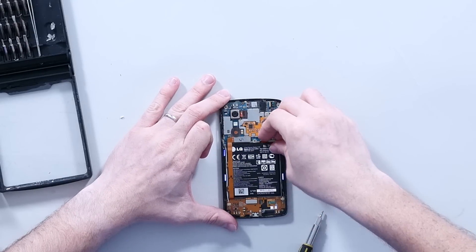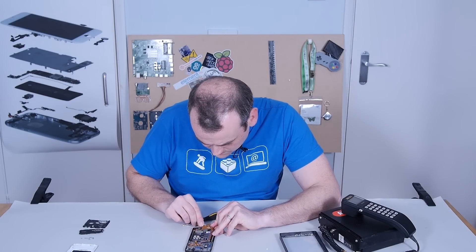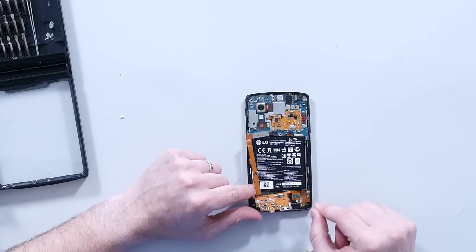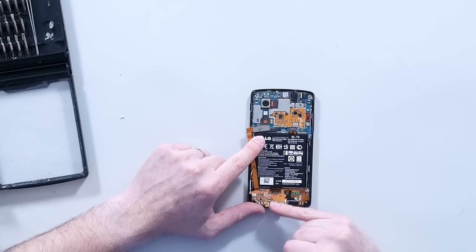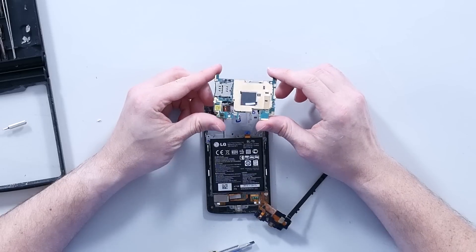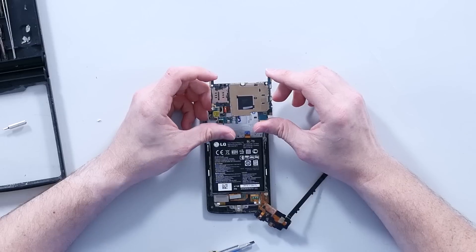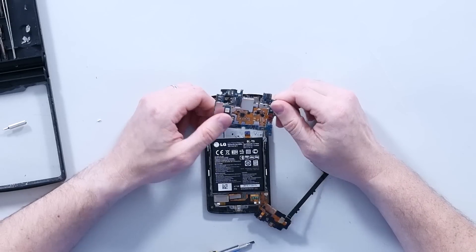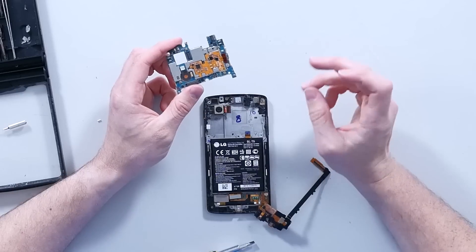Now we can start pulling off the battery connector. The bottom board has the charging connector — which, I'll be honest, is disgusting, full of absolute rubbish. There's actually a second one; I think this has got the display driver on it as well, which is why you've got this quite wide ribbon with a good number of connections. The screen and display driver is at the bottom of the phone. On this main board is principally the system-on-a-chip, which contains the RAM, the processor, and everything functionally needed to make the phone work. The only thing separate is the main storage, because the cost is lower to put that separately on the PCB.